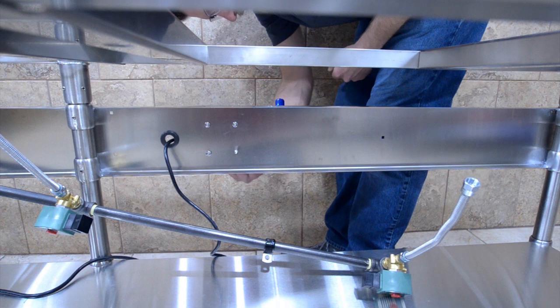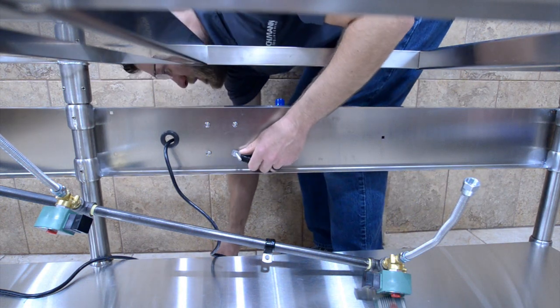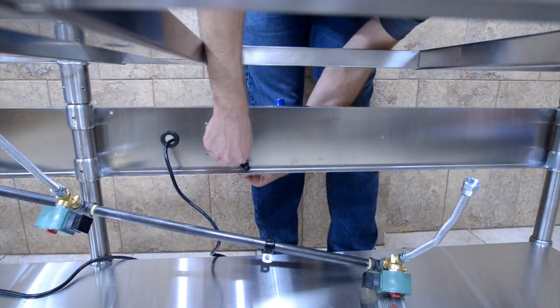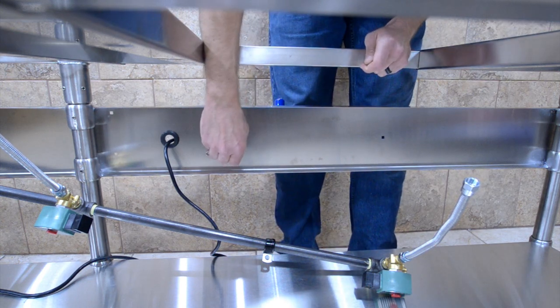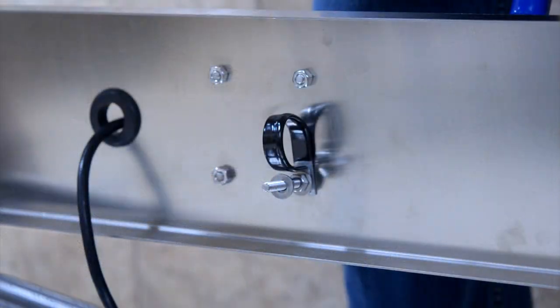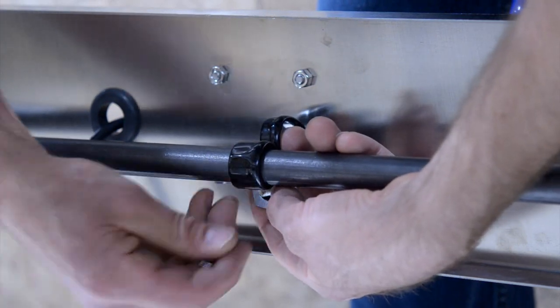Use the 2 3/4-inch hex bolt with 1/4-inch washer on the outside of the empty hole on the left riptide. Then use the 1/2-inch P-clip, 1/4-inch washer, and close with a nut on the inside. On the same bolt, place a nut and 1/4-inch washer halfway down the bolt. Mount the P-clip on the gas manifold to the bolt and close with a washer and nut.